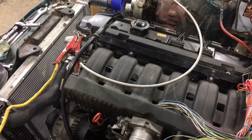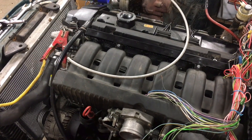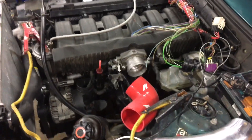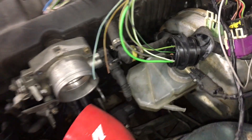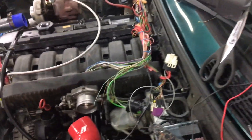Well, the problems are definitely not all solved, but the new starter at least. Just priming it a little bit to get some oil in there since it's been so long. I'm still trying to figure things out — idle control valve is not buzzing, the DME is getting power. I've just got wires plugged straight into the C101 at this point, going through and reading some online diagrams. I've done this swap a few times before, but it's been a little while so a refresher course is needed.